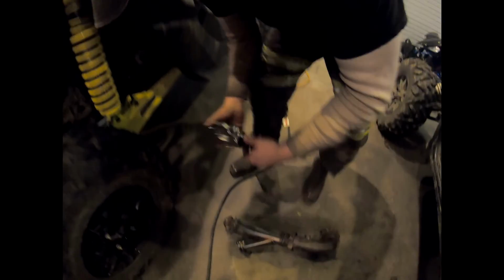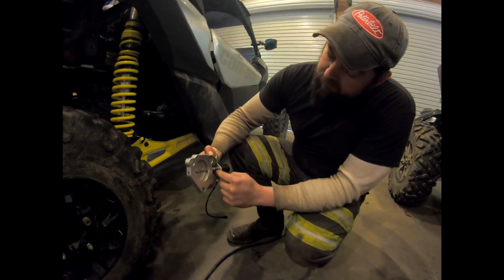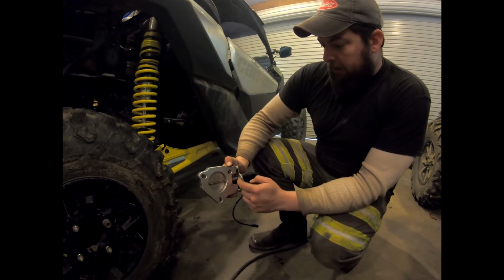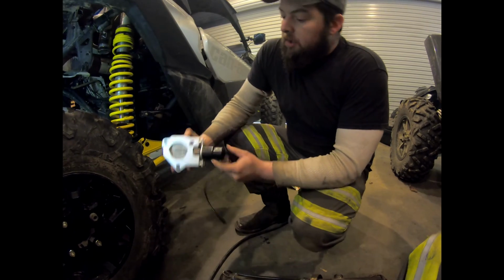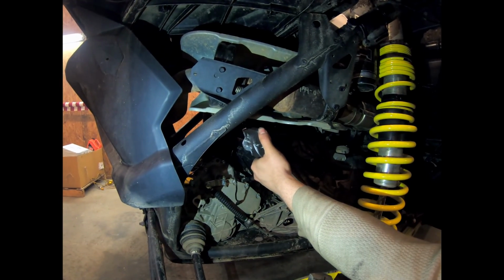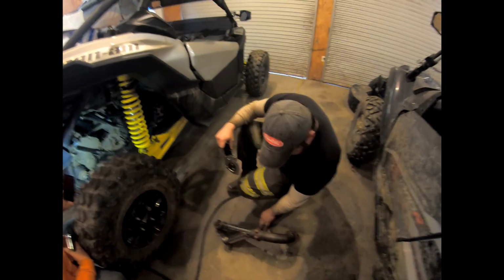So, as we were saying, as you can see, this valve right here, through the stem that actually opens and closes the butterfly valve, that's a place for water and dirt and debris to get into. Also back here on the electrical pigtail, even though it's booted. So we didn't want to turn it up that way. We wanted to keep it kind of horizontal to the machine. With that all sitting in there, it will keep it protected. You can see the machine's a little bit dirty, but in there stays somewhat clean. So we felt like that was the better place to put this.